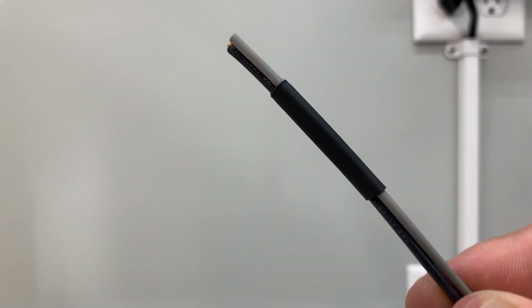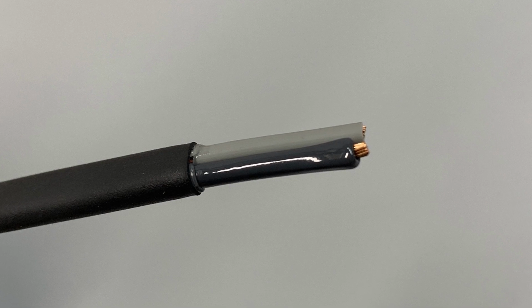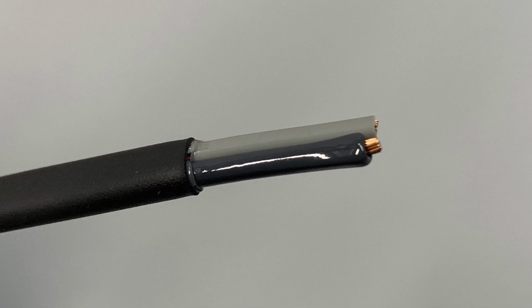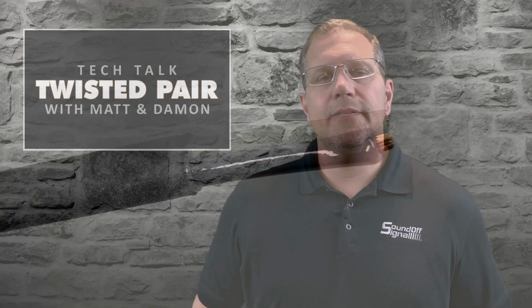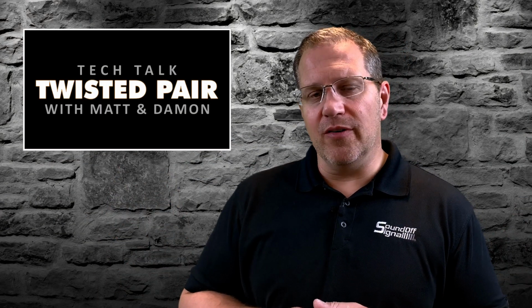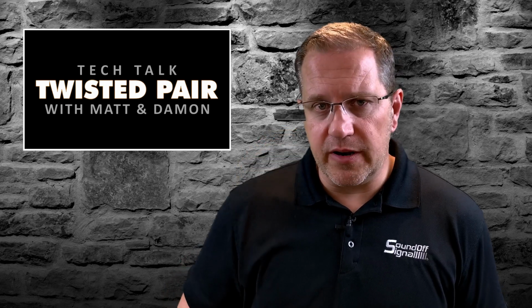And here it is damaging the GPT wire, causing what's called pullback. And that's where the wire kind of shrinks back from the end of the conductor and it bulges out a little bit. It'll get really glossy and deform, and it damages the wire. And you can, again, see the crosslink wire that's coupled with it shows no damage, no issues whatsoever with that heat.